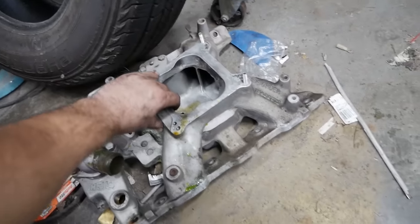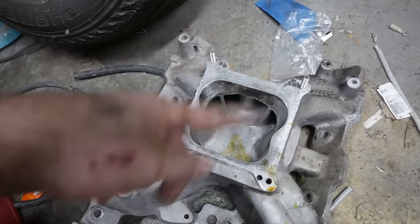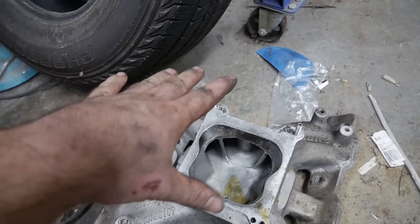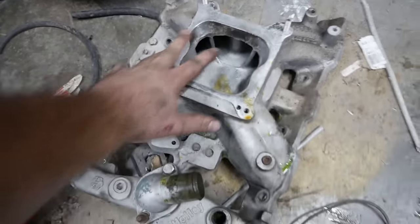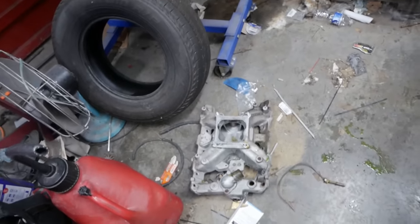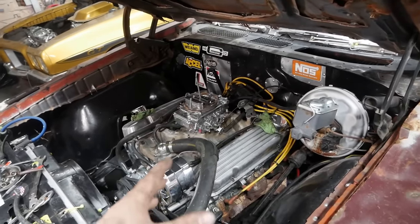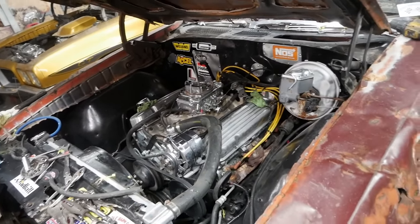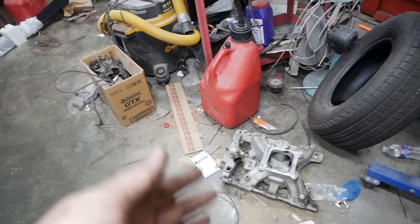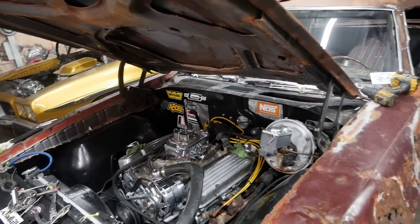This is a single plane intake — basically just a gigantic hole. The carburetor is like the toilet tank on top — it's like an ultra flush that feels like it's going to suck your insides out. The dual plane is stepped one size lower; you get a lot more low- to mid-range power out of a dual plane. Although for whatever reason that single plane ran spectacularly well on this car, all things considered.